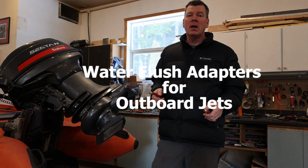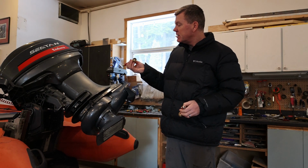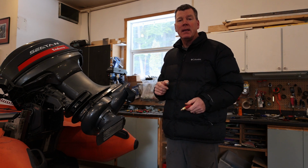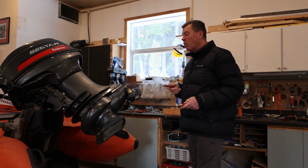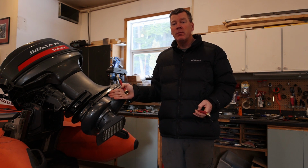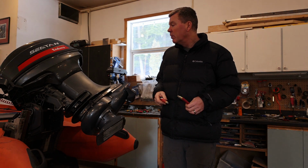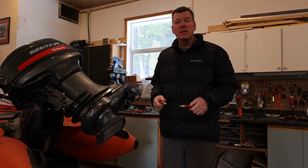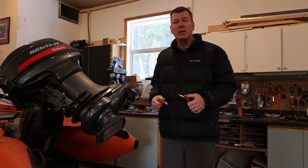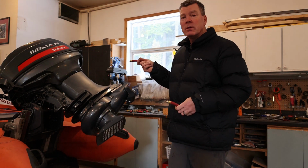So in this video, we're going to talk about water flush adapters for outboard jets, which is essentially just an adapter for your garden hose to run water into your outboard jet. And this serves a couple purposes. One is to flush your motor out to prevent corrosion. Maybe you've run this thing out in the salt water and you want to flush it through your motor here. And yeah, you can do this at home without having to go to a lake or another freshwater system to flush the engine out.